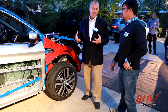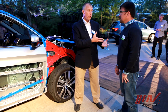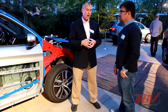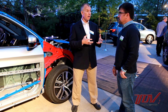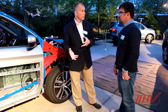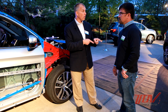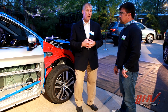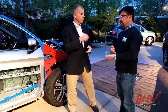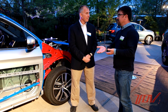This is one of our Earth Dreams technologies engines. It's a 3.5 liter, now direct injected V6 with VTEC and VCM — the variable cylinder management. It goes in six cylinder mode, but also in three cylinder mode when it's appropriate for better fuel economy. It is up 30 horsepower to 280, and up nine foot pounds of torque up to 262. That results not only in better performance, but a couple miles per gallon fuel economy improvement as well.